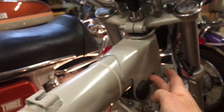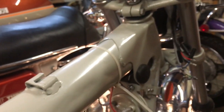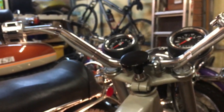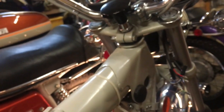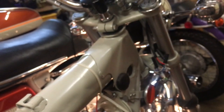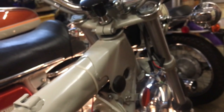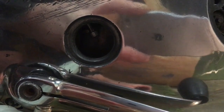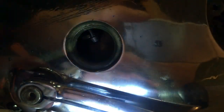I'm not going to route it properly for now because I need a new rubber cover for where the cables slot through the frame. So we'll arrange it temporarily on the handlebars for now, which will still enable us to test and if necessary adjust the clutch, crack on and put the primary drive cover on, and reroute the cable from the top end at a later date.